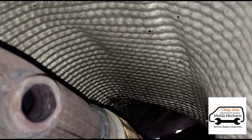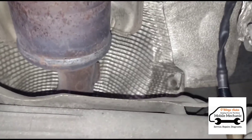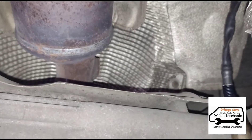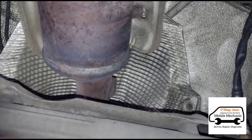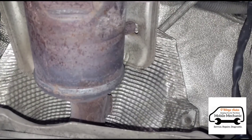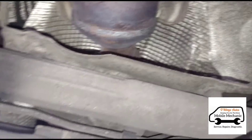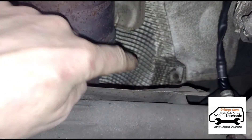Here's the problem on this car - it's the O2 sensor port, and the sensor is just dangling on the car. The story with this car is she recently just bought it, and believe it or not, this DPF was fitted brand new. She got a receipt for it before she bought the car not long ago - a week or two before she bought it - and a few days after she bought it the O2 sensor had fallen out.